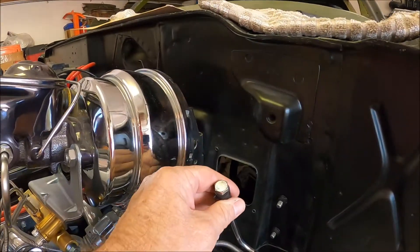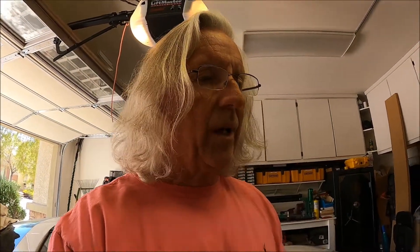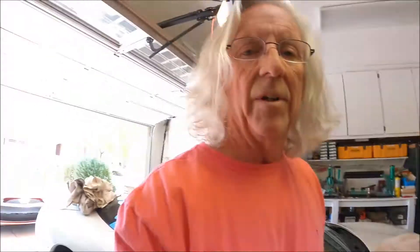This is part of the emission system — this goes to the vent system on the gas tank. I have all those capped off; I'm not going to run it. That runs to the charcoal canister. You're supposed to have a sealed thermostatic air cleaner — what all this was actually supposed to accomplish I don't know, some California stuff. The car originally started out as a California Camaro so it did have some smog equipment on it, but I've since got the car retitled in Nevada and none of this stuff was required.